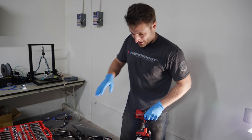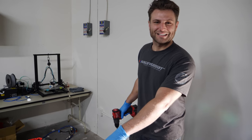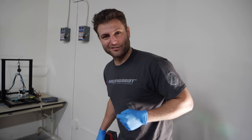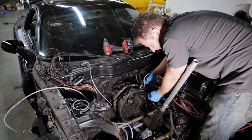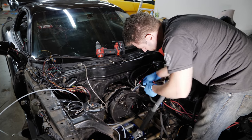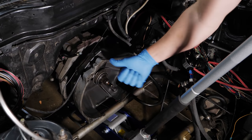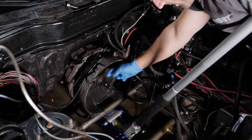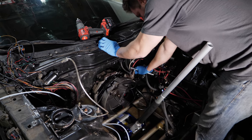While waiting for the bell housing from a second-gen RX-7, we're going to take the one already out of the three-rotor — it's exactly what we need for the Corvette. I'm going to take this off along with the torque tube and take them over to Build to Apex. For those familiar with FDs, they use the exact opposite type of clutch as a Turbo 2. A Turbo 2 pushes the clutch in whereas the FD pulls the clutch out — you have to lock the throwout bearing to the clutch. This setup makes it much simpler, more like most common clutches, and is extremely serviceable.